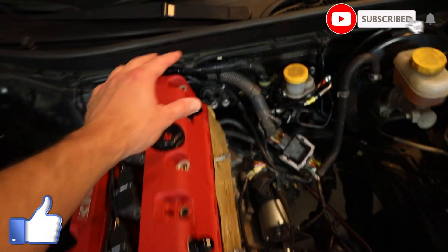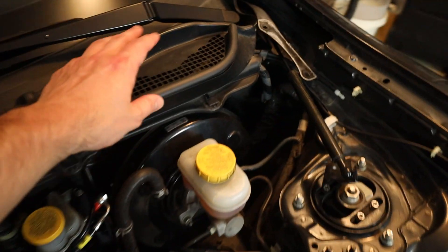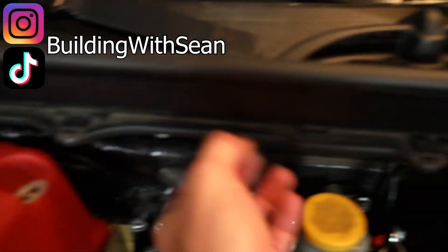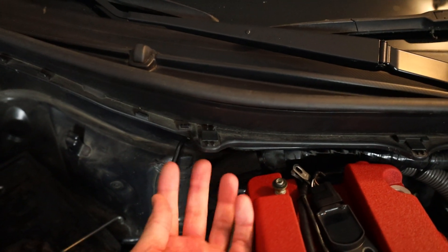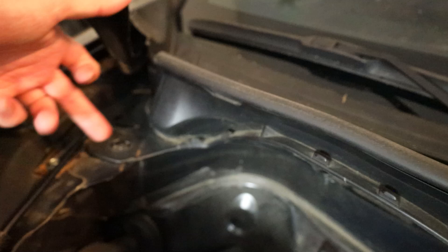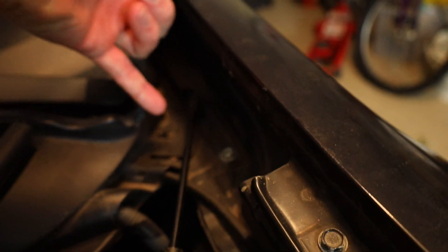The first thing I want to comment on is that as I was putting my engine in and getting it mounted, I actually removed this cowl for the windshield wipers. It covers the wiper motor underneath, so I went ahead and got that back in. It was really just a bunch of these little square clips — once you get it positioned right it all snaps in. There were three clips in total that actually popped out: two here and one little guy by my pinky.